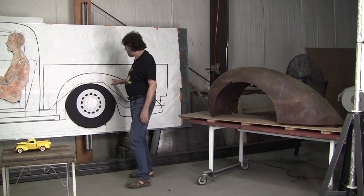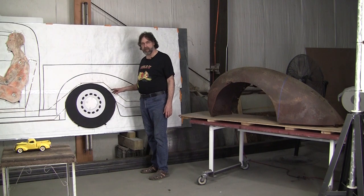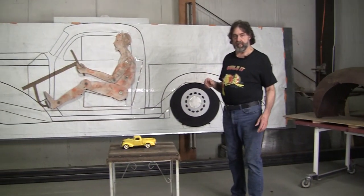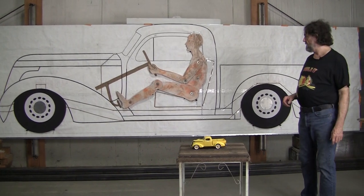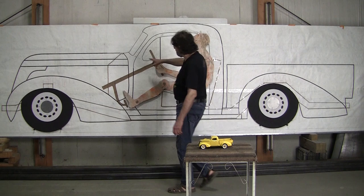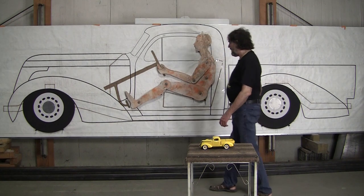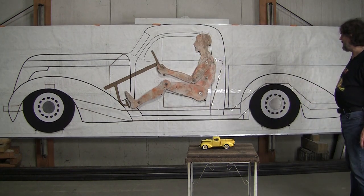From this front fender, all these curves — basically from here back — is the exact same fender shape as the rear fender, so that made the job of making that wire form for the rear fender a lot easier. Peter bent all the wires — I showed him how — and then it's all MIG welded together. In a minute we're going to show you that. I've also got the steering wheel in, a cowl firewall line in, and the brake pedal position. We just threw some wheels in to jazz it up a little bit.